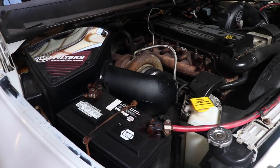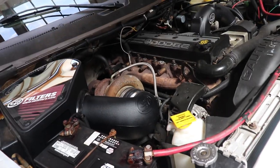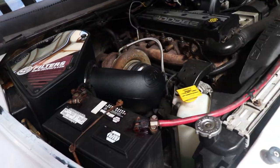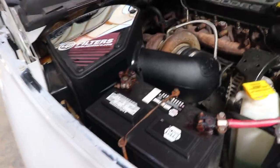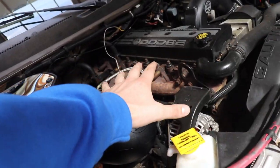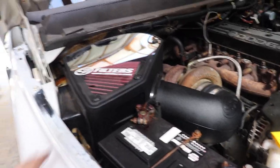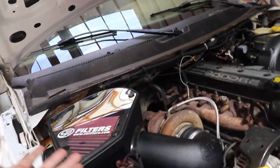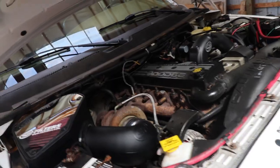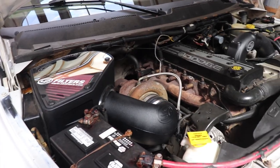The other stuff that was in here was just a factory pipe hose with an intake slapped on. Some trucks don't have many options — like first gens, they just drop an intake down by the bumper in the fender. But if you have the option, pulling in actual cold air that's not from right up against the manifold is usually the best way to do it. Cold air is definitely going to produce more power than hot air, because cold airflow is what makes power.